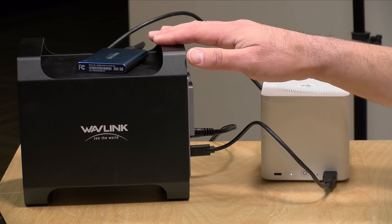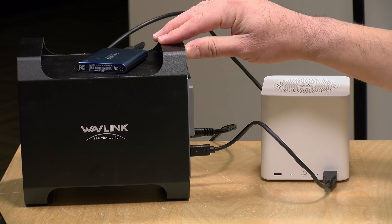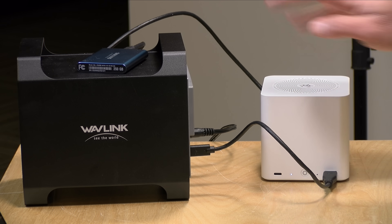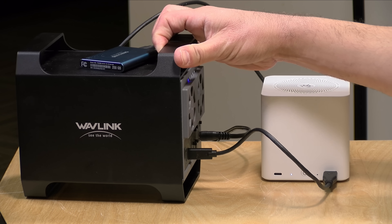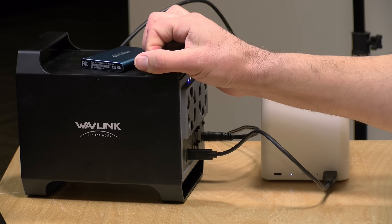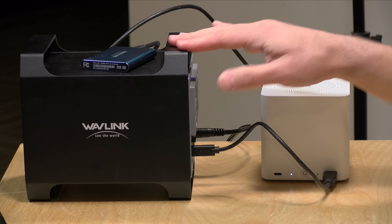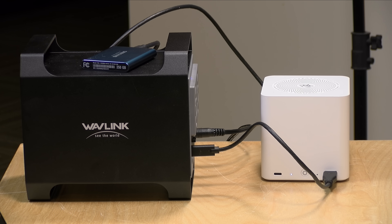When it came up, my parity drive was no longer working, although my data drives are okay. I think it's related to the drive controller versus the port compatibility — this array is also kind of a USB hub with an HDMI output and USB-C pass-through, so that could have contributed. I'm not happy about the parity drive failure, so what I'm likely going to do is get a couple more NVMe drives and try to go completely solid state, since I have about nine terabytes on my media server.